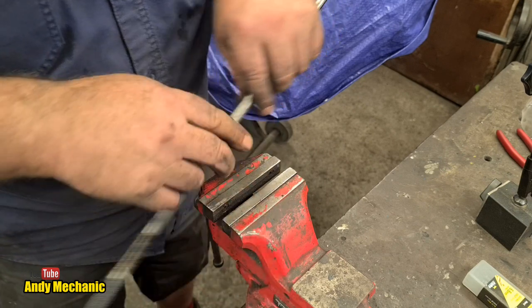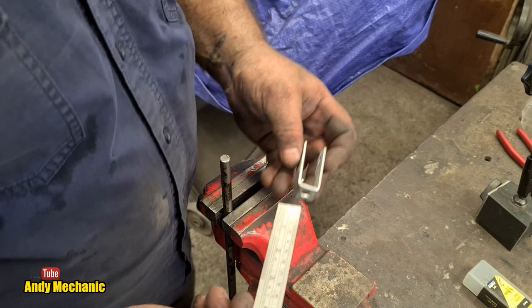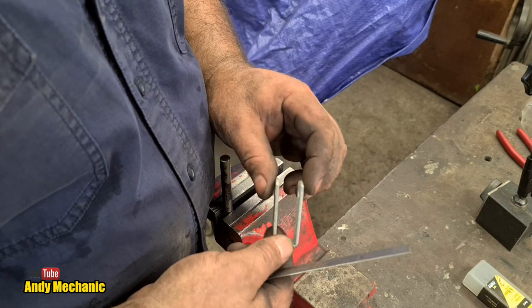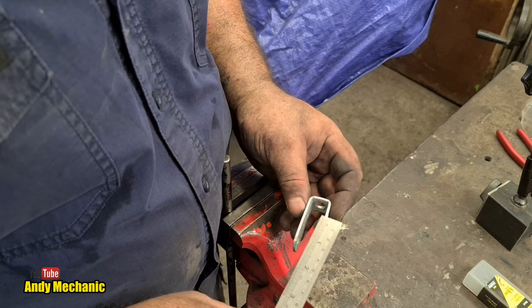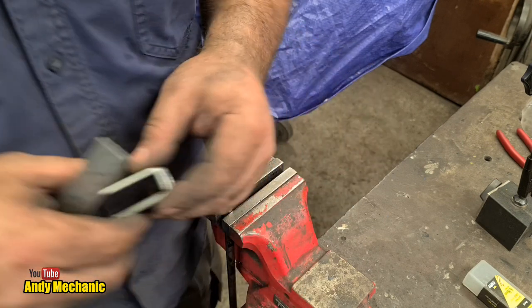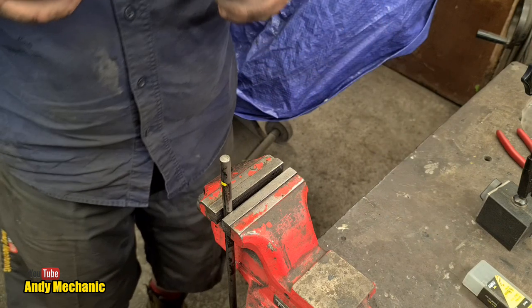That's actually not too bad, is it? Okay. Without the lathe, now. This one is for the pivoty end, the balance plate. Look at that, that's well in the middle, isn't it? Good job, people. Now, the thing with trailer parts is, because it's trailers, there's no quality sometimes. Anyway, no accuracy. Right, so we said about 15 mil in, it needs to protrude 2. So if we go 25, that'll give us room for a nut on the back at 15 mil in. So let's do 30, just to be on the safe side. Gives us a little bit of wiggle room then, doesn't it? So 30 mil. We get down to the yellow mark, we're done.